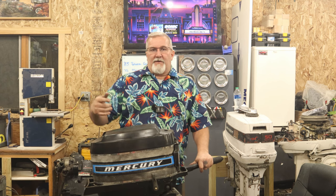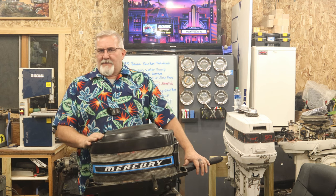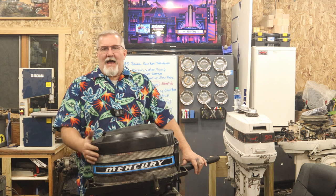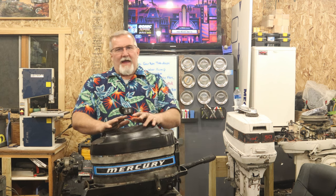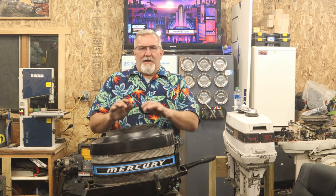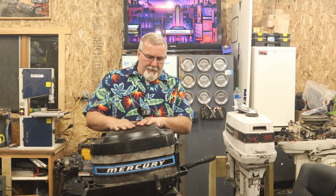It's not letting the air come through. For some reason, it's pumping a little bit of air, but it's not pumping any water. So I'm gonna check the thermostat out. I also had a really high pitch metal on metal kind of ting, ting, ting up in here when I revved it up.